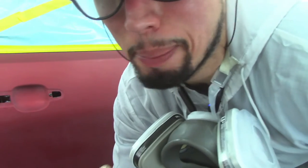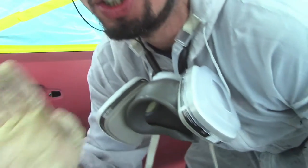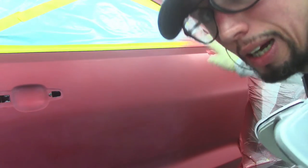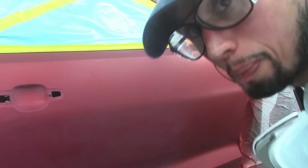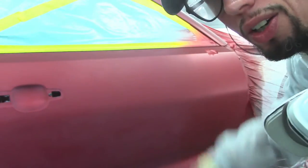In that video I just cover how I do the clear coat. This video covers the whole step and whole process so you guys know everything I do when doing these kinds of jobs. My panel said two coats of clear was good enough and matches well with this color, so I'm going to put two coats of the tinted red clear, blend it out on the door and on the bumper, then put two coats on the fender, and then two coats of regular clear on everything.